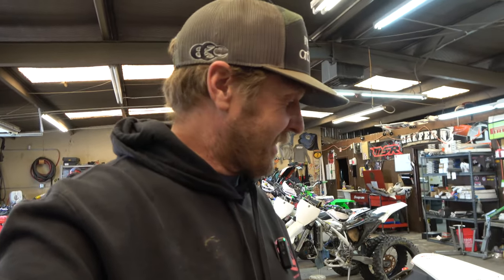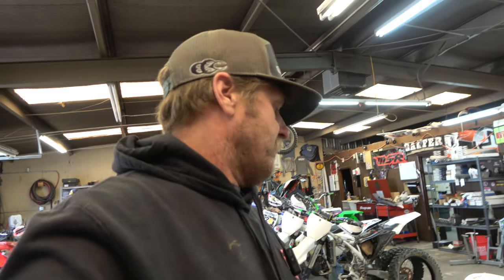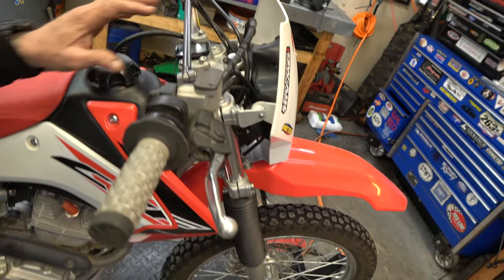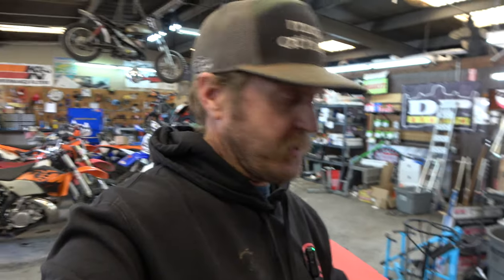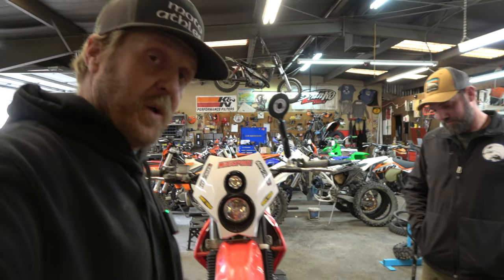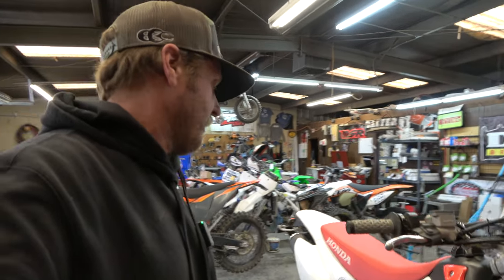That's a really important one, guys, because it's an aluminum hub with steel bolts and steel nuts, and sometimes it'll squish and then loosen up and cause all kinds of problems. So those are nice and tight. Really happy about that. Hit our pinch bolts on our bar clamps. Brakes all work good. Suspension feels good, bouncy, just like it's supposed to. So that's about all I can do without riding it. We just went through it. Everything's great. Super happy with it.